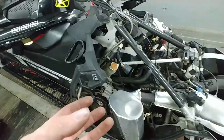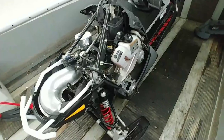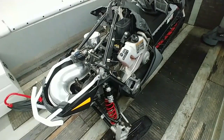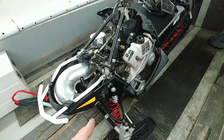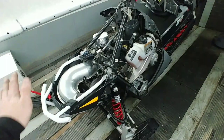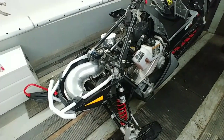The sensor needs to go all the way back so it can read 700 millivolts. After you get 700, you come back up to the throttle cable and dial that set screw up until you're at 940 millivolts — that's your idle position. My throttle position sensor was in the 800-something range. This weekend I went riding and I'm very pleased: dead cold start is now two pulls instead of three, and it starts right up.